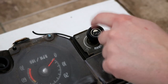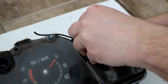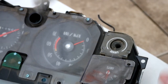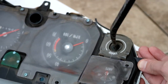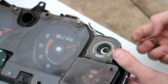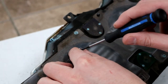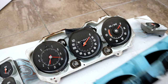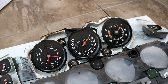I'm going to be retaining the headlight switch. Pull the knob off — there's a little push-in button on the back, so extend it out to the max, push that button, and out it comes. I then needed to take the whole headlight switch out using a pry bar with a nice flat blade to spin it out. We can't forget the knob for the clock either. Just like that, it's off — let's wash this up and then work on getting the new one installed.